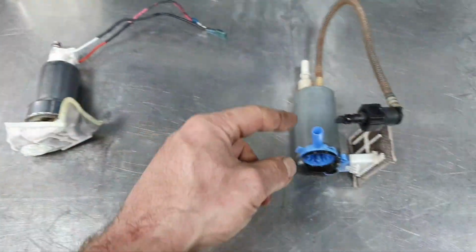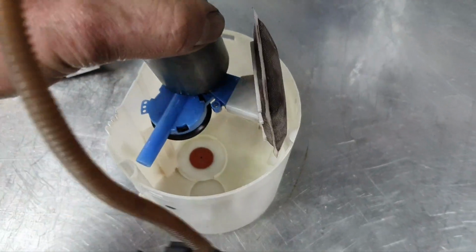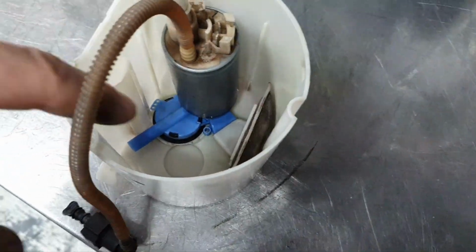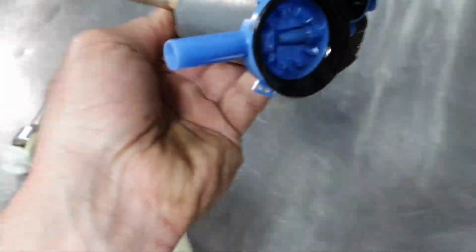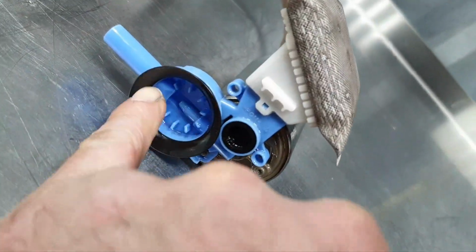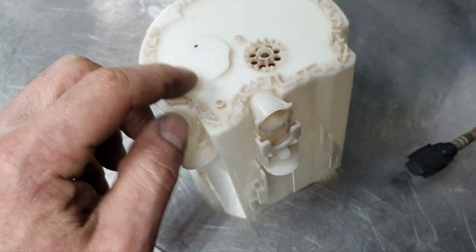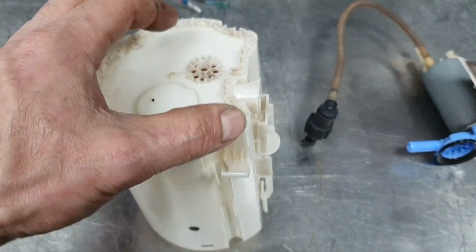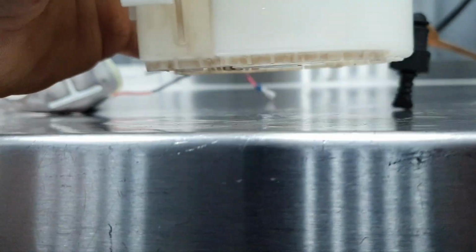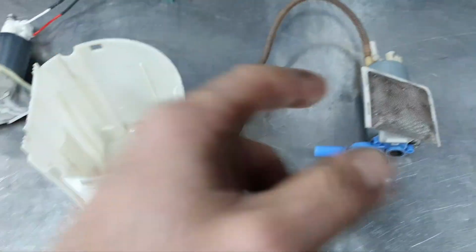Now, the original pump sits at this point there, and it's sucking fuel. There is one valve here, like a Venturi, and it's sucking through this membrane from down, and that's why you see the bucket cut like that. There is this opening here to not sit completely down on the fuel tank, to have a space for the fuel to pass and have suction for the pump.